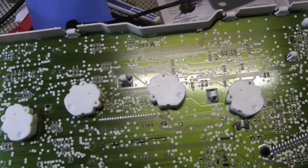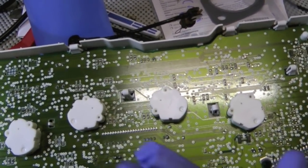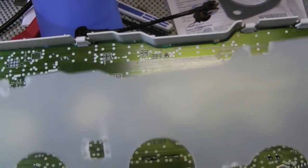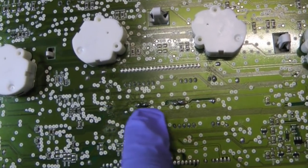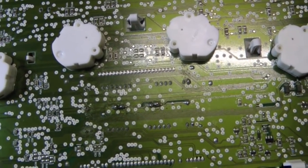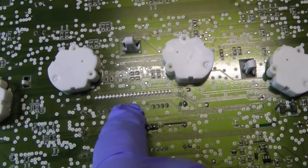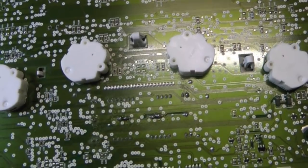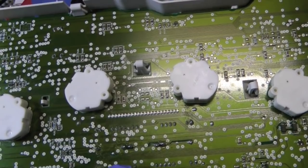It's soldered in on each leg. You do not have to remove the other side of this to get to any of this — you just take this plastic piece off and you can do all your soldering. You want to check all of these and make sure that they are good, because mine was working great after I soldered all of these little ones and put it all back together. Then lo and behold, I started getting the DIM odometer again, and there was no continuity on this middle one here.